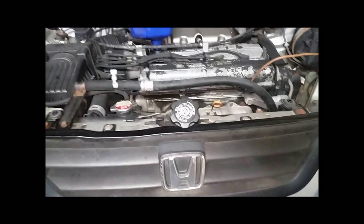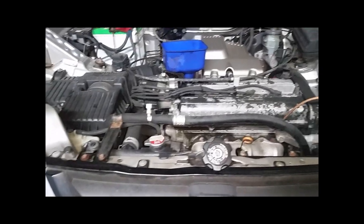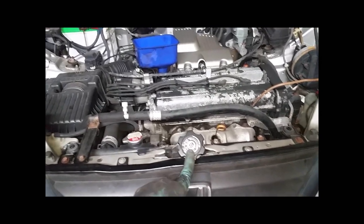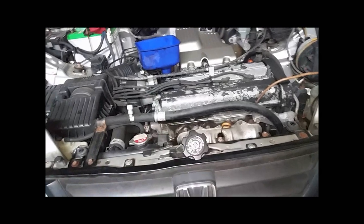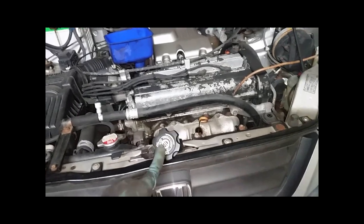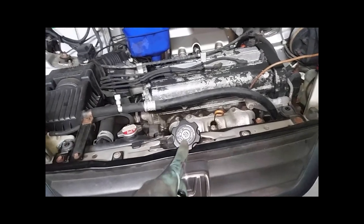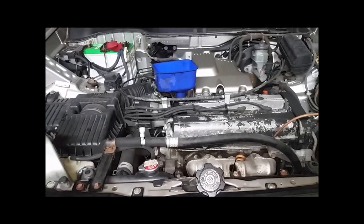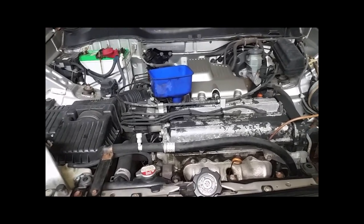Since we're doing an oil pan, you can see I have the oil fill cap off and a funnel there. This is a habit passed on to me when I first started as a lube tech — leave the oil filler cap here so you don't forget to put it back during an oil change, because that makes a mess and leads to irate customers. The funnel in the filler neck reminds me the oil has been drained and I need to put oil back in. No matter how good you are, you're no better than a careless lube tech if you forget.